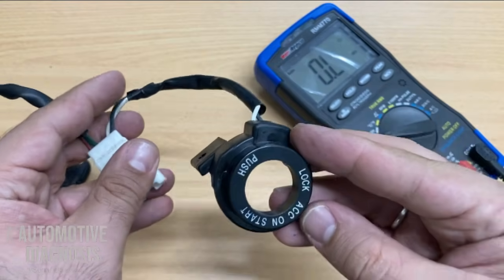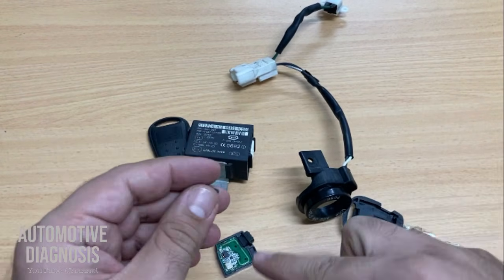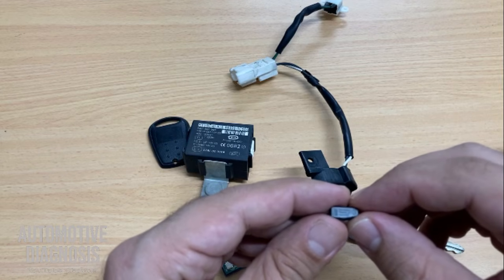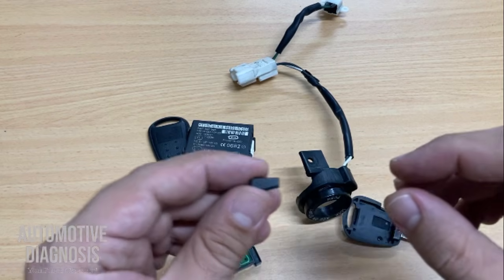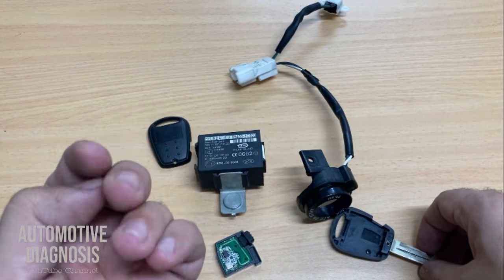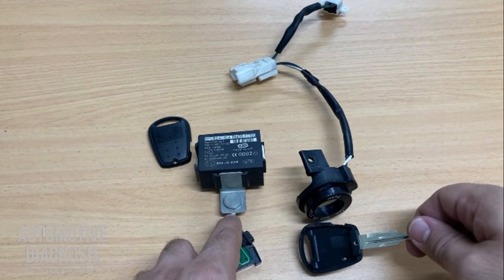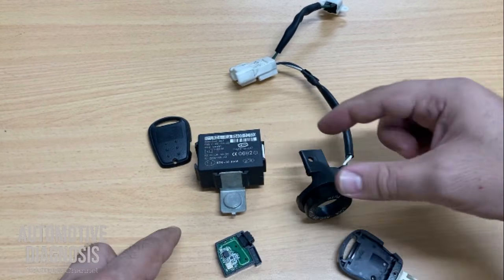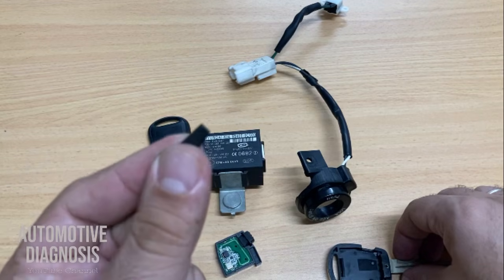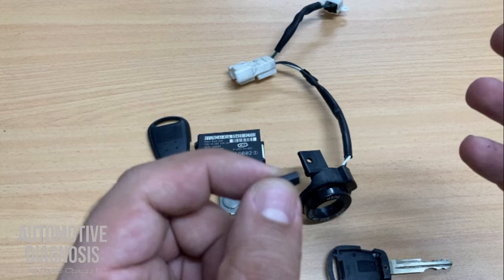As you can see, I'm reading the resistance value. If the resistance is not within spec, the antenna coil is damaged. If the immobilizer system is not working properly or any component is faulty, you won't be able to start the engine, because the ECM will not activate the fuel system without confirmation from the immobilizer. In case of any failure, the quickest check is to try the second key — if the second key works, it means the antenna coil, immobilizer control module, and ECM are all okay, and the problem is most likely the transponder chip in your original key.